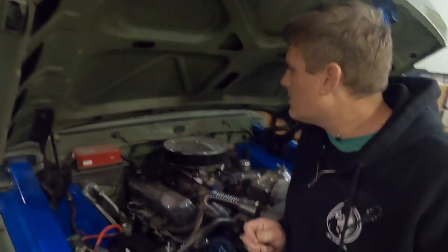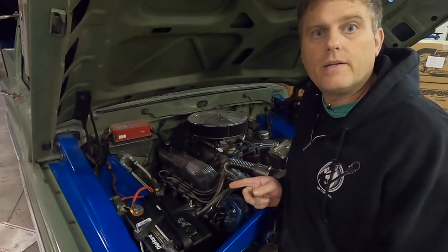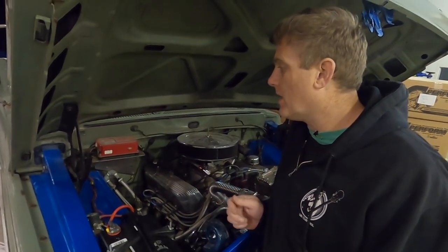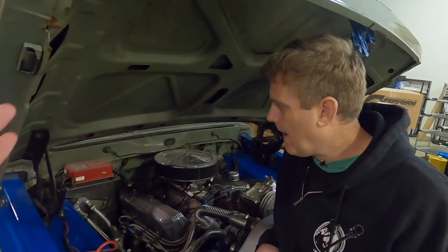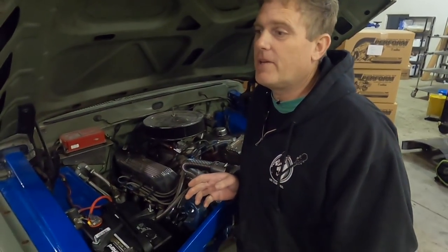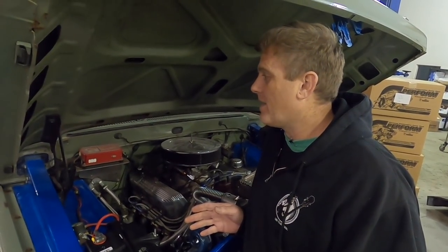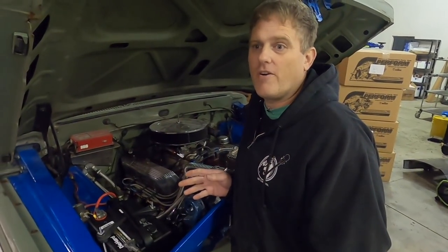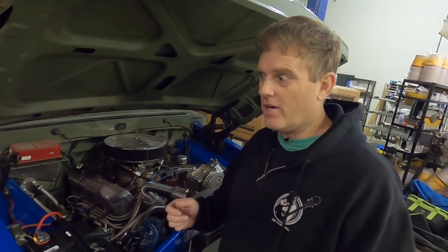This is one of the older MSD boxes — the newer ones have a plug you can just unplug, but this one is pretty much hardwired in. When we trace the draw we may have to actually cut wires or find butt connectors to disconnect. Also inside there's an aftermarket radio and CD player — any time you get a draw on a car with an old aftermarket radio, there's a good chance that's the culprit. Most draws I've found have been old, bad radios.